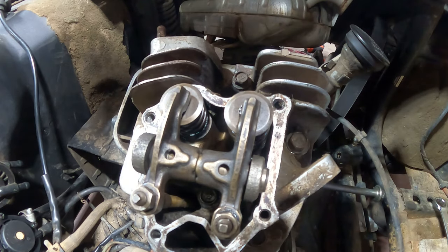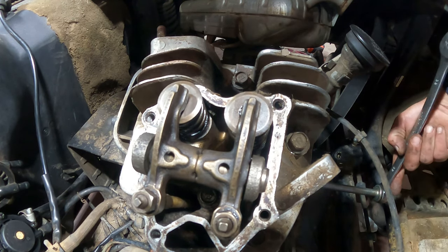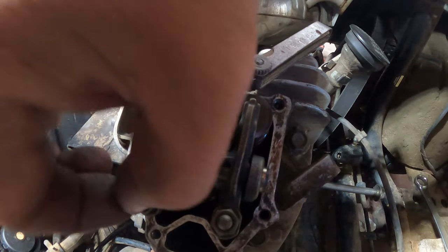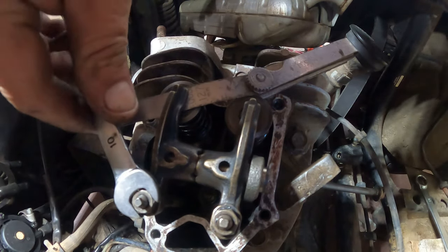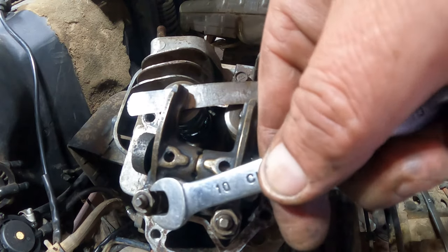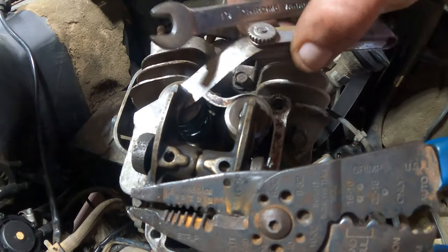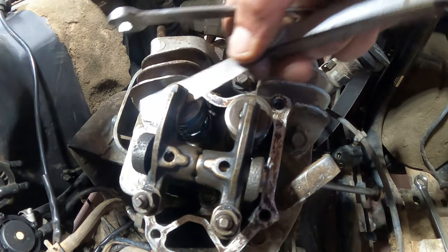Good drag on her. I'll go the other way. So the exhaust is going down, so we know this one's fully up. So all I'm doing is just turning that little bolt in there until it gets kind of firm, where you don't want to force it down. The feeler gauge won't read right. If you can see that there, turn a little bit. So we back it up just a little bit. Come on. There we go. We'll hold that right there and tighten. Nope, she's too loose.